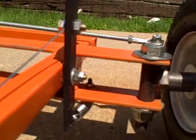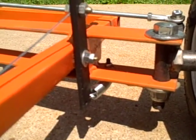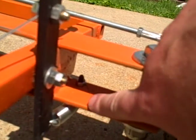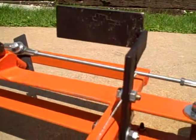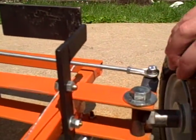The arms are just two pieces of metal that sit on top and below the frame, and I doubled up with one inch tubing in between. So that's all welded together — there's two inches between here and here. This is just flat stock that was cut and then welded to the top. It's plenty strong; even with my 215 pounds it doesn't really bend.